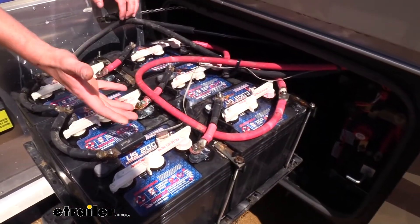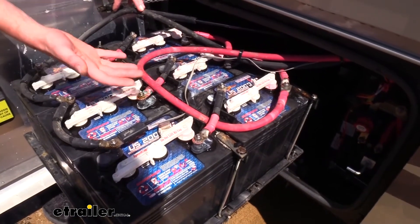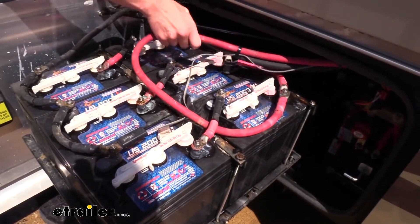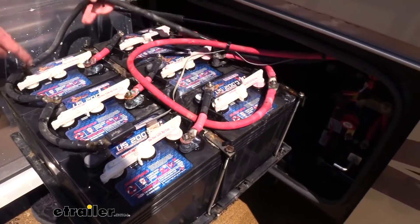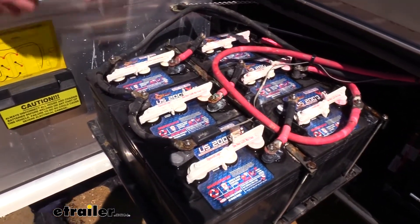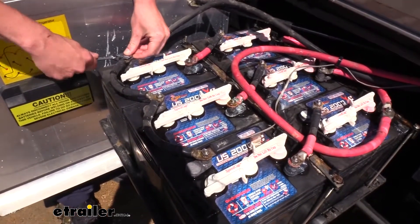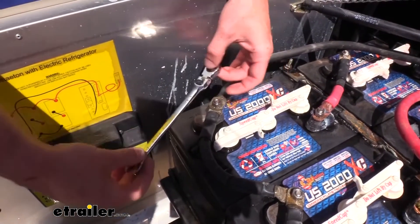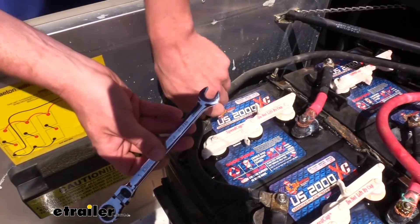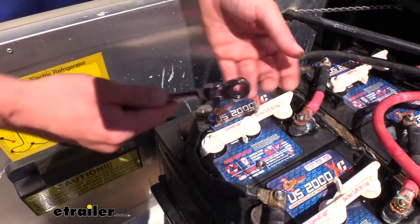If you've got a little bit of moisture still on here, it's not a big deal — these are six volts wired for 12 volts and with such low voltage you're not going to have to worry about any shocks or shorts. We're going to start by removing the main battery cables first — we've got our positive and our negative, and we'll start with our negative. The size wrench you're going to use is going to vary; for ours it's going to be a half inch. You want to do the negative side first, because if you accidentally touch anything that is grounded when you're taking off the positive side and the negative is still attached, you can cause a short and sparks with your wrench.